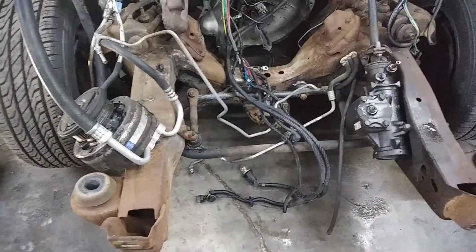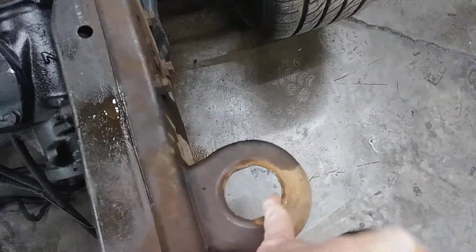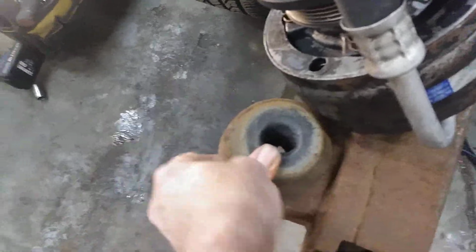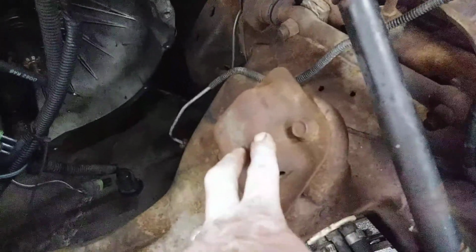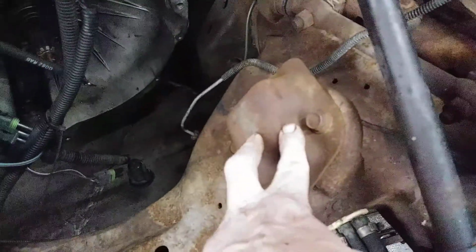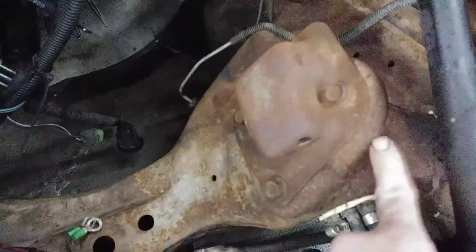But yeah, just surface rust. All of this is good up here. Most of the time some of these rot out, but I thought I'd have to go to Safety Cap to get another set of those repair mount things, but nope, they're solid. And it's the first time I've ever owned one. All the S10s I've done that I've ever had one, most of them were 2.8s or 2.5s that had these. So I'm wondering if I can unbolt this even with this stand and it not being down flush to the frame. Put a 2.8 mount back on there and go with that.